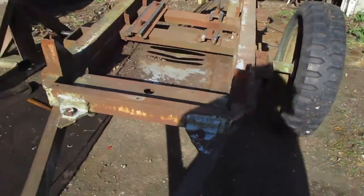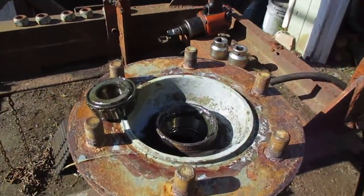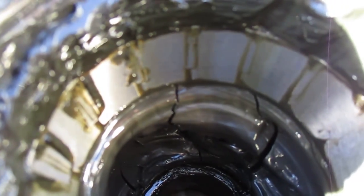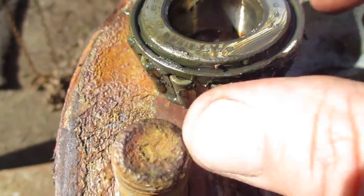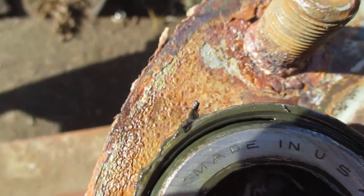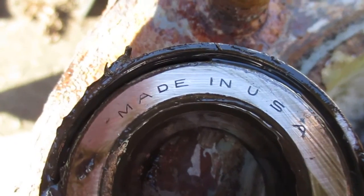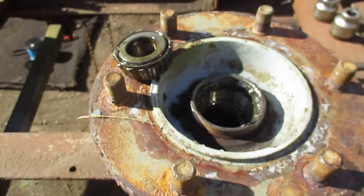What I'm doing now is some vehicle maintenance on the old trailer. I've pulled the hub and I'm checking the wheel bearings — not only for grease, but to see what the needles and the cup look like. That cup looks really nice along with that bearing.